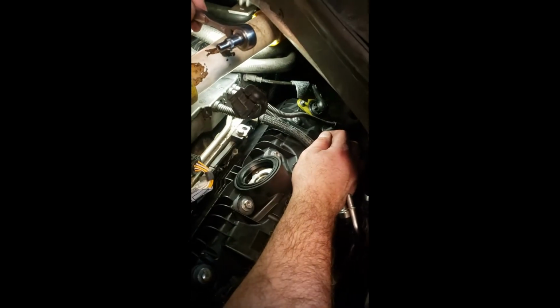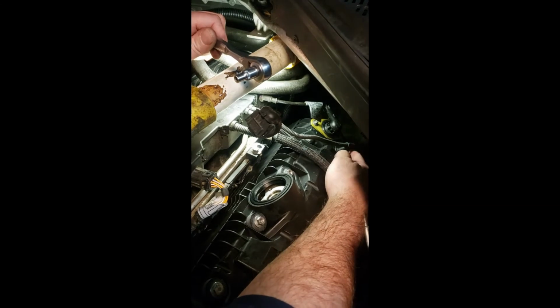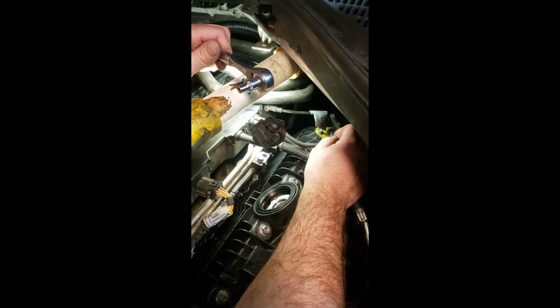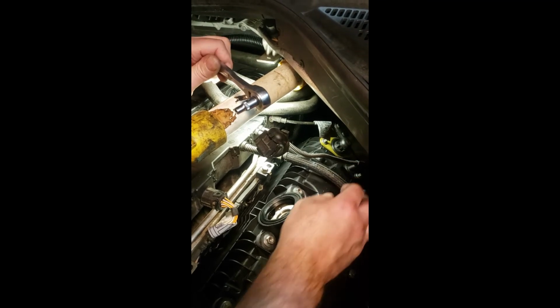If you start getting crazy motor faults, you know, typically on this side, on this bank, check your connections. Make sure that these two are seated good back here. You get them in nice and tight. Make sure that the pins are actually seated in there and that thing is clicked in there. I've seen a couple other guys online where they said that they didn't get that quite right. Backing out now, we can see.